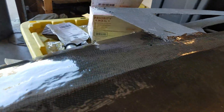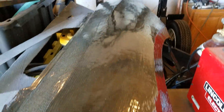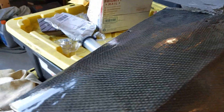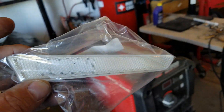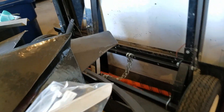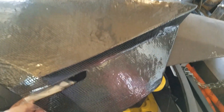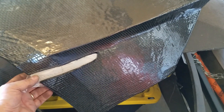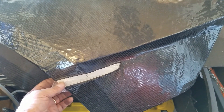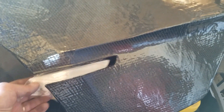We've got two coats of epoxy on the rear driver quarter. We're going to be blocking that out, sanding it down, and flatting it off. The other thing I had to do is fit these beautiful Lamborghini marker lights — these are actual Lamborghini ones and they go right here. I had to cut the opening out for these, and then we'll build a bracket to hold them and panel a piece to the back of the quarter panel. We're going to do the same up front — putting some of these on the front bumper as well.